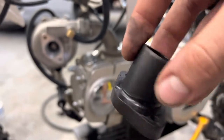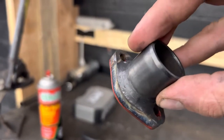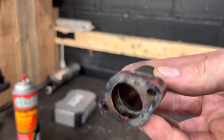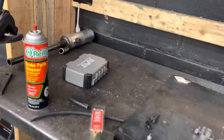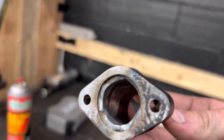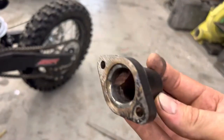Originally I welded it to the wrong flange — this one, which was actually the intake flange. It looks very similar, so it was my mistake. I TIG welded it and it had horrible discoloration; it needed a lot of heat, which could have potentially warped the flange. I did do it at an angle on purpose. After that lesson, I learned to weld it on the inside, and I MIG welded it. Then to deburr it I used a carbide bit on my tool so that it's a nice clean straight bore.